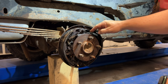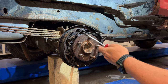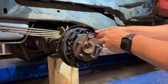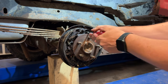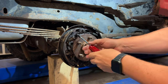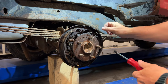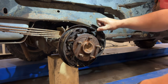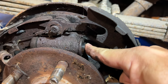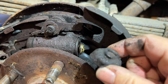Let's take a look at this cylinder and see if it's even savable. I have a couple of brake spring tools — this is the typical old-school one, and this is a really neat one that clips onto the spring and you tighten it down, giving you a really good grip on the spring. Here's the dust boot and the cylinder, which has fallen out. We can see the seal and the spring — so this is why it was leaking so much brake fluid. I could just push this back in and put it all back together, and it might seal up.